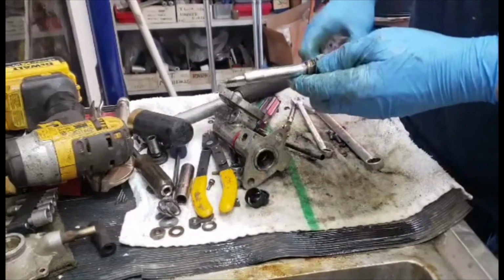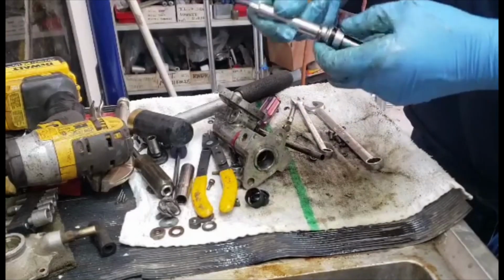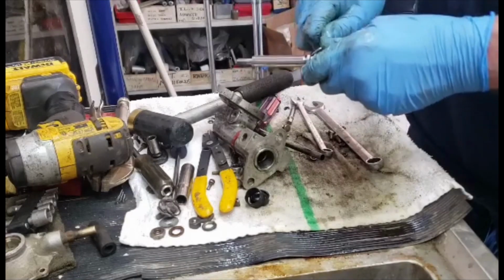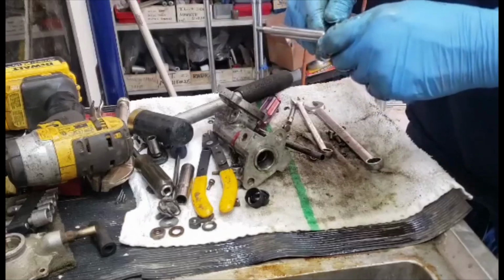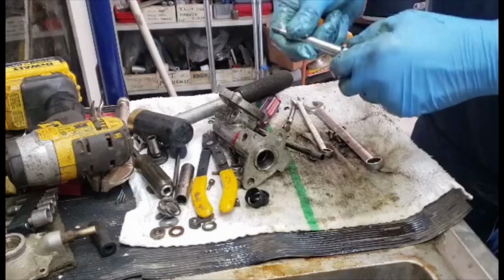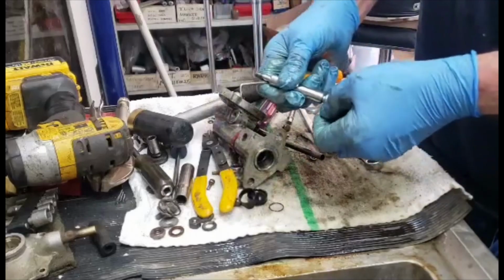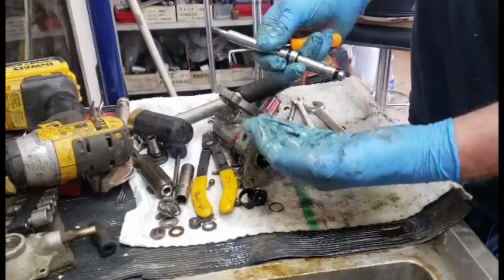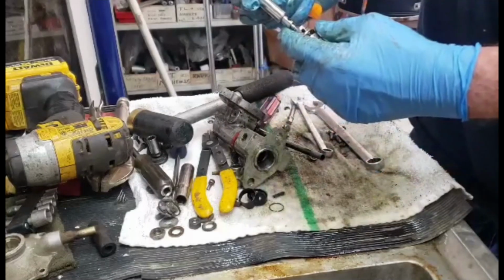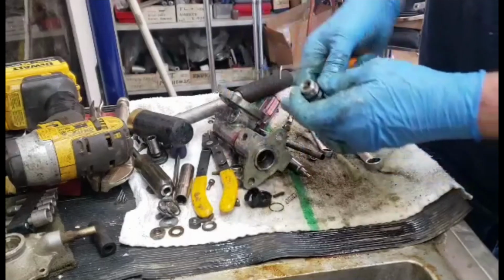And then there's a snap ring here. You take that off, and then take off the push this pin out. And when you push the pin out, that's about, I'm going to say 1/8 inch because I don't know what the metric size would be. So here's the end of the push rod. There's a little spring here, and there's a ball bearing beyond that.